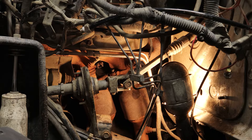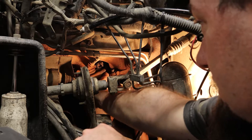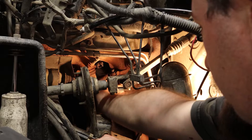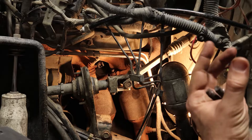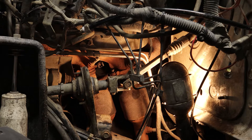Now I have them out. These are basically like clamps - these flanges that fit on here and the bolts go through them. Now that it's off they just kind of hang here. These don't come loose yet because my oil pan skid is still on there and that's basically holding the exhaust up. So hopefully once I get the oil pan skid off, these will just kind of come loose and fall down. Once they fall down I should be able to get the oil pan off and finally get to the gaskets that I'm trying to get to.